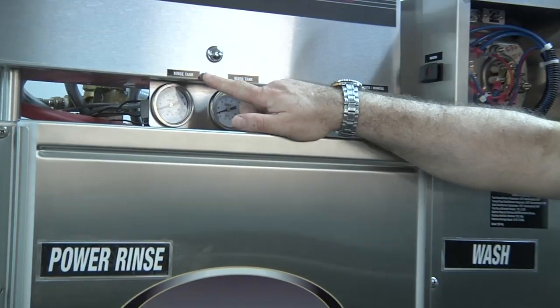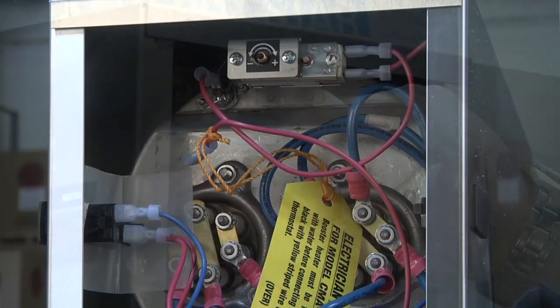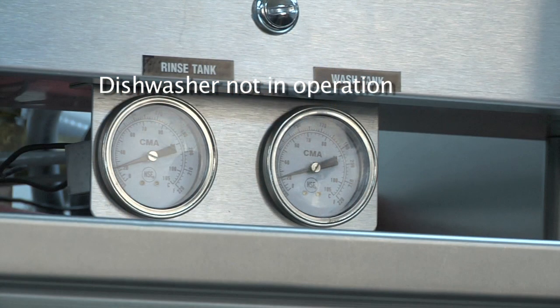The temperature gauges are located at the center of the dishwasher — the wash tank and the power rinse tank. To adjust the final rinse temperatures in the ETEM booster heater, the thermostat is located at the very top of the booster heater inside the main control panel of the unit. The temperature gauge and pressure gauge for the final rinse are located over the final rinse section of the dish machine. To begin setting the temperatures in both the wash and the power rinse tank, feed several racks through the dishwasher and observe the temperatures of the machine, then make the adjustments for the thermostats.